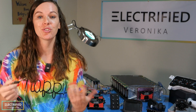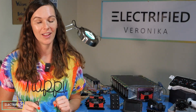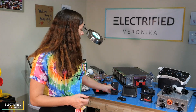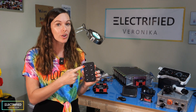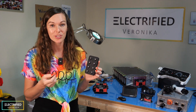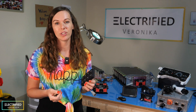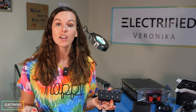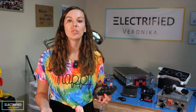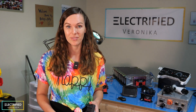The next big step is setting up all the communication between those components. When I turn the key in my soon-to-be electric Jeep, the system needs to know to turn on the low voltage system by closing the contactor. When I press this button, the system needs to know I want to turn on the high voltage battery pack — so the pre-charge resistor and then the main high voltage contactors get closed. There are user-interfacing functions to control, but also lots of communication that needs to happen automatically.